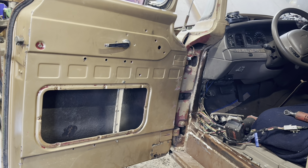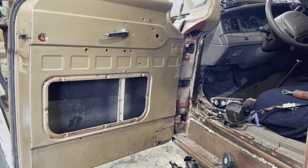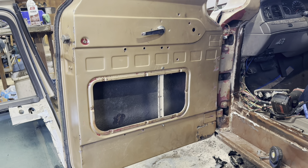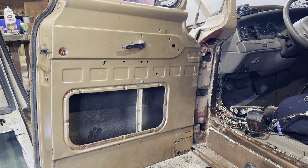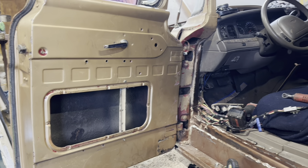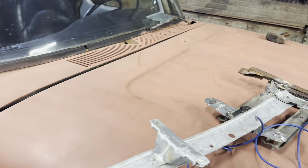It's like seven days out so I don't know if it'll be in this video or not. I mean, there are other things I can wrap up and I can do some body work. I may just go ahead and order it because I think it's going to be a whole lot easier. If this track was straight the window motor goes up and down with no problem — it's just that the track's not straight; it's curved. I tried to kind of bend it straight but it just kinks it. It won't work.